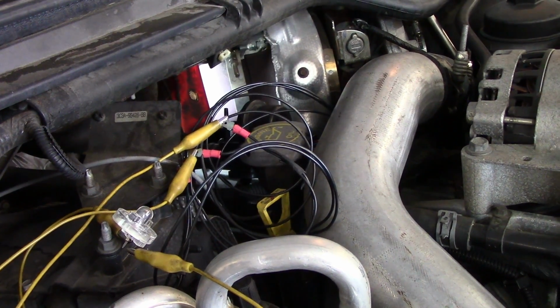It's injector time. Now, it's 100% definite on the injector. We don't have to worry about the engine or anything like that because we actually have an injector circuit code, because I mean, it won't buzz. So, I mean, we can go one step further and check the resistance of the injector, but we don't need to.